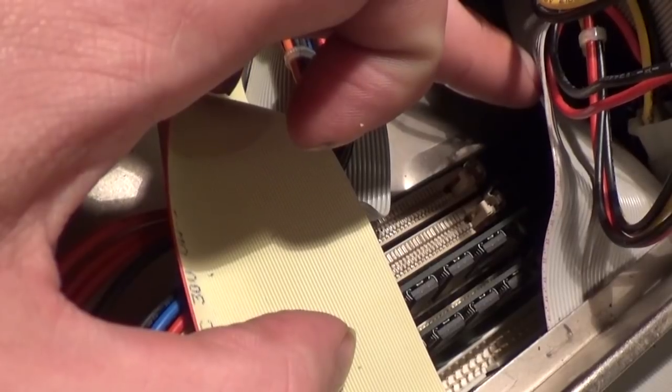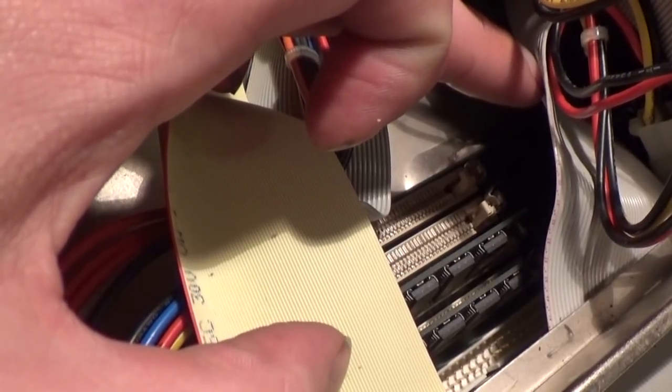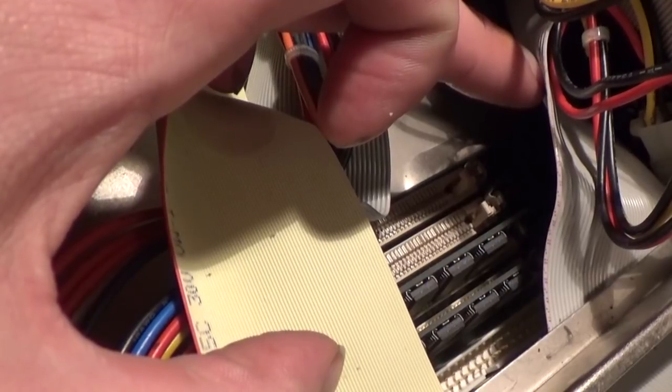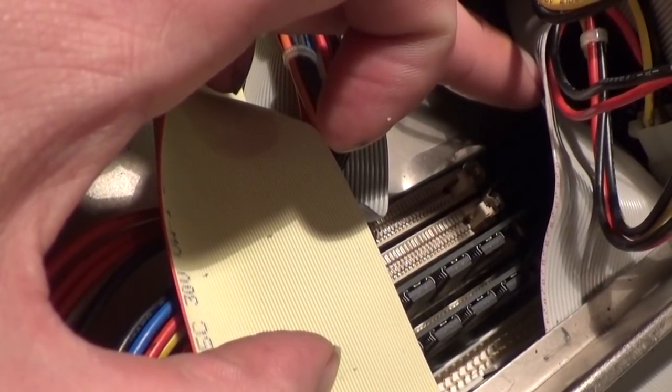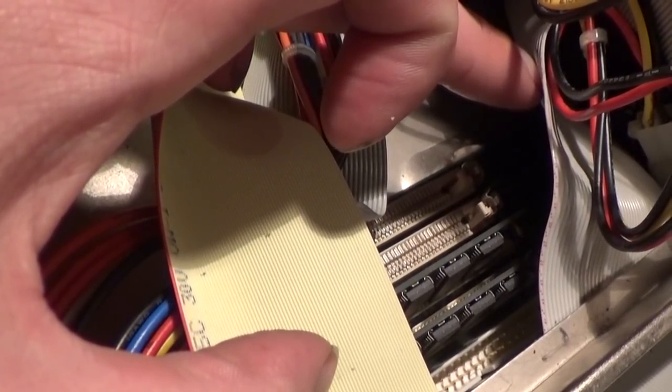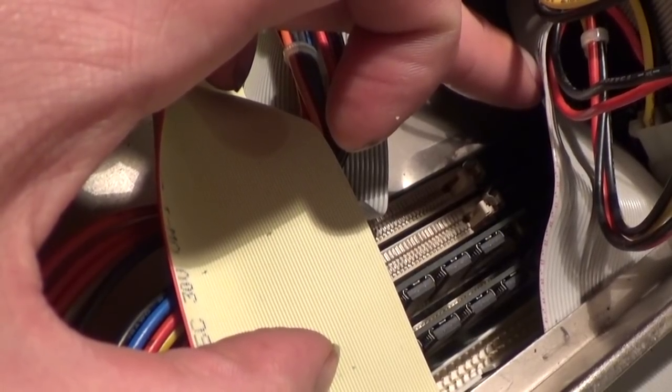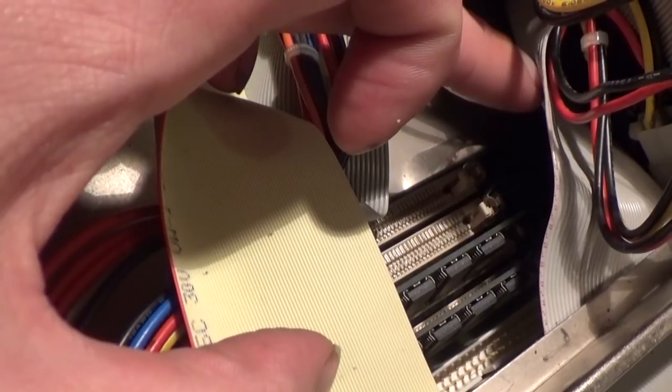Still, 256k of cache should be correct for this in write-back mode, so you can probably see why I'm happy to drop that back, as this board doesn't do pipeline burst cache, and I don't need more RAM. In fact, I dare say this is generally overkill for Windows 95.